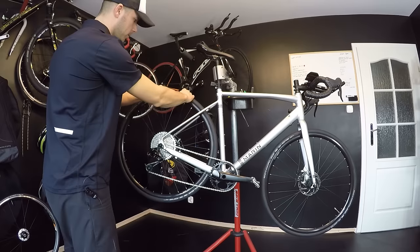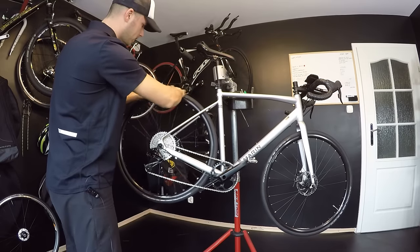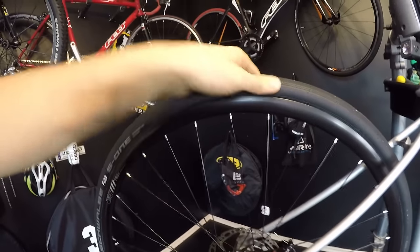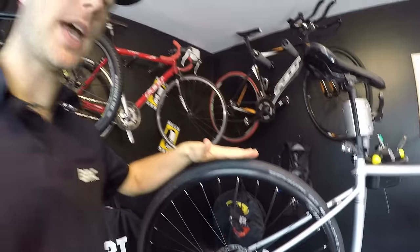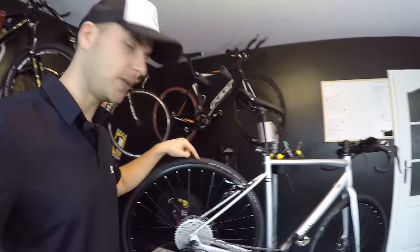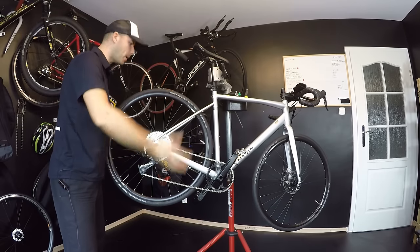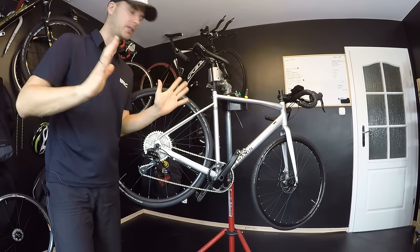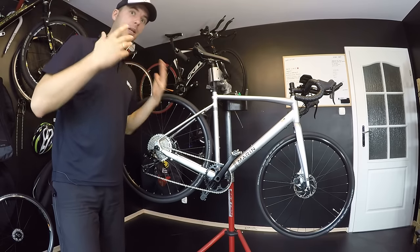By pushing the sidewalls from both sides with your hands, you are helping the tire to fit into the walls of the rim. You should have as little air as will still let you move the tire around in the wheel. This is important because you want a true wheel and tire, but also quite often the bead of the tire can bite the inner tube if it's done too quickly. If you put the inner tube in, lock the bead, and pump it up all at once, the inner tube can go just a little bit under the bead and then you lose the inner tube.